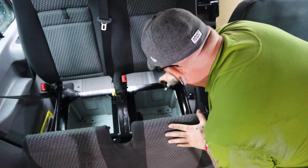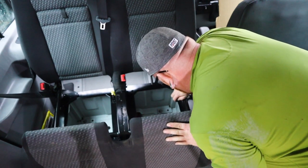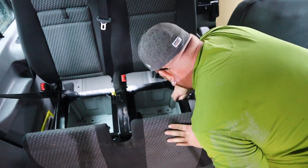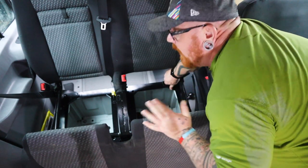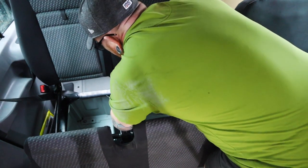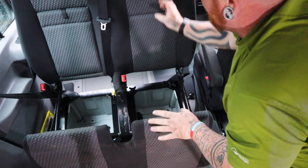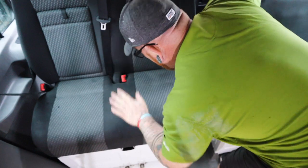Right there. Take a couple of your bolts and pop them in. You're not going to need all eight in if you're not moving the vehicle, so we just put two bolts in and that way the seat can't move. You can fold it down and it's done. You then have a seat facing backwards that you can sit back in and just relax.